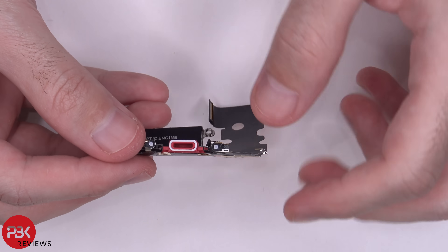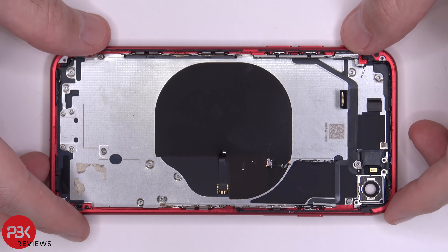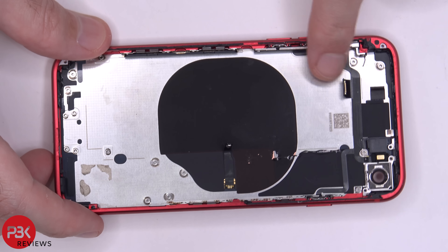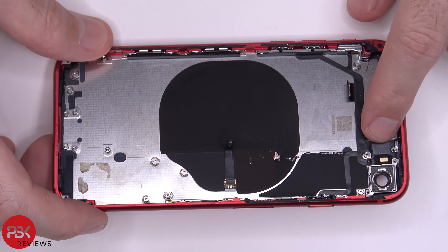Your charger port has a rubber gasket around it. At this point you're left with the frame. You have your volume keys over here and your vibrator rocker over here — the flex cable for that runs over here. There's the connector for the board. It also connects to your power button switch over here and your flash for your camera.